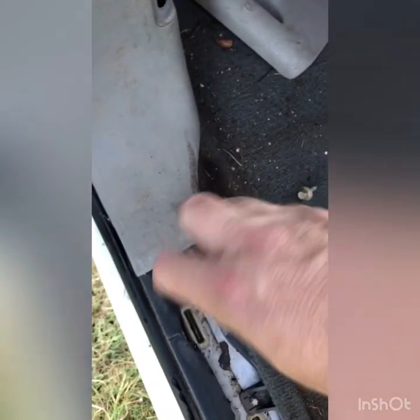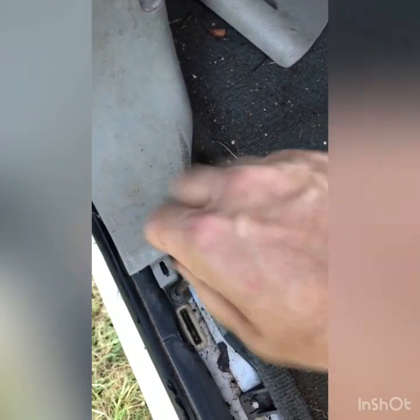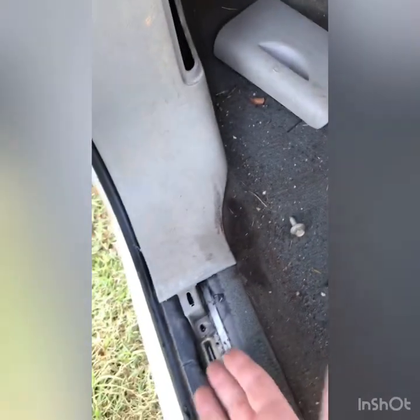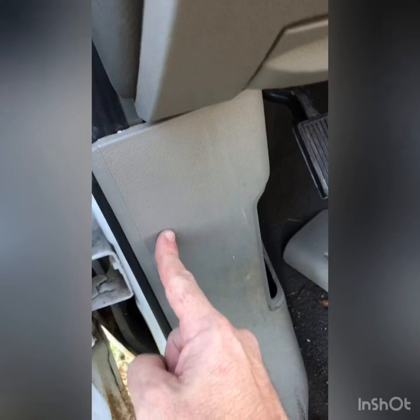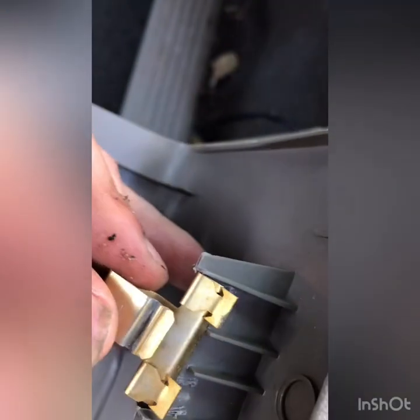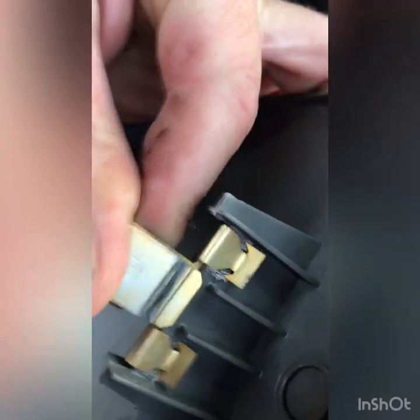I forgot to mention — you're going to need a Phillips head screwdriver. This is the first screw you take out. Once you do that, this panel here has a clip here and a clip here. Pull it straight backwards with one good hard pull. The clips stay in there, but that's fine. What I do is I just transfer them after I get it off. Do this before you go back together because it can be rather tedious if you don't.